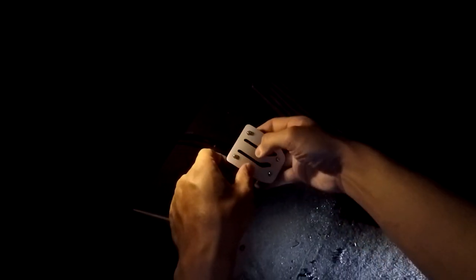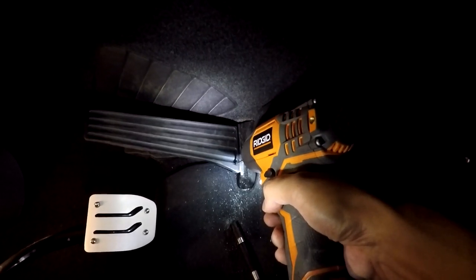Second pedal done. Last one — it's getting dark. This one feels like it's made out of plastic. From what I'm seeing, this hardware is not long enough to go all the way through to behind the pedal, so I'm likely going to have to make the holes a little bit smaller just so these catch and thread in. The markers have been set. These are just plastic so not much work involved — for them to properly thread in I'm using the 3/32 drill bit.